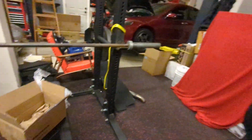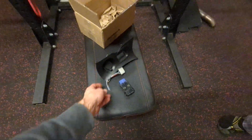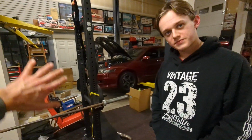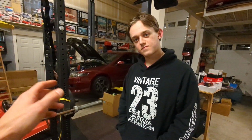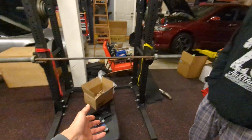And then what else are you going to need to get? Well, I'm not exactly sure what all I need, but I'm assuming there's a wiring harness and the actual rods that go under the seats that heat them up. Usually there's an element, not rods, and they go behind the material on the seat, and we'll have to wire it up. There's going to be a relay, right? A relay is an electrical switch. You use a low amp switch to trigger a relay to pass a high amp circuit, because you need more amperage to get seat heat.